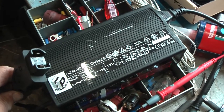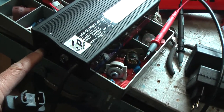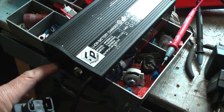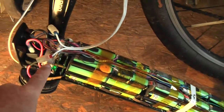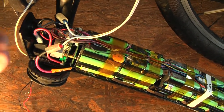This is the charger of my BH Emotion Neo Jumper bike with the connector. Right now there are two small screws inside there, and one of them you can set the maximum voltage. To experiment, I set it at 42.5 right now, or maybe even 43. But still then, my battery does not charge at more than 40.0 volts. I suspect the BMS to be the cause, because all batteries are equally filled. So the balancing is doing fine, but the cutoff for charging is cutting off too quick.